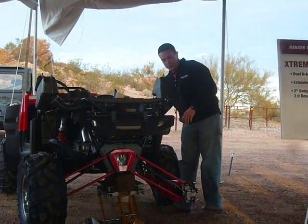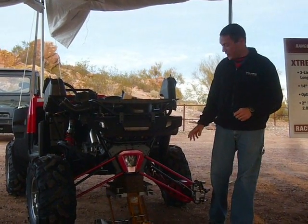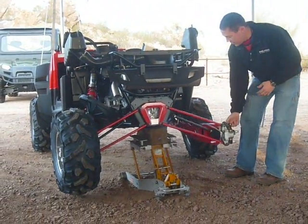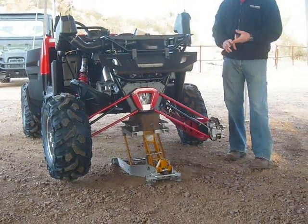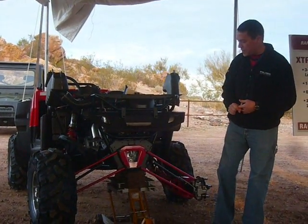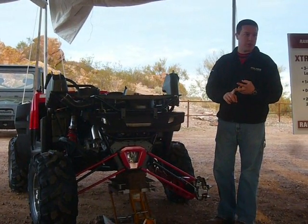Now what you guys really want to hear about: this new, cool, three-link trailing arm long travel IRS. We got 14 inches of travel back here. You might ask why we did the three-link trailing arm versus the conventional control arm that most other side-by-sides have. A couple of reasons: strength, and packaging for performance.